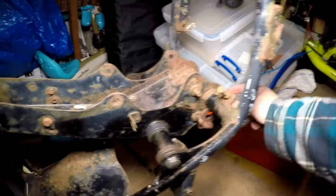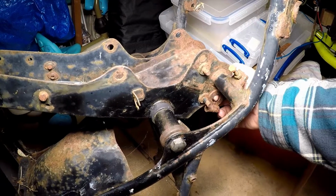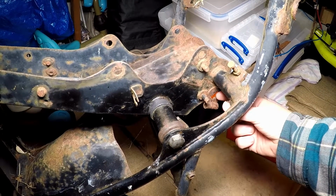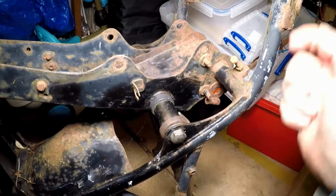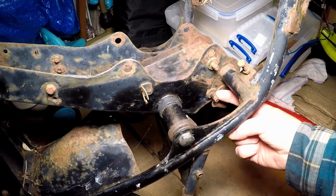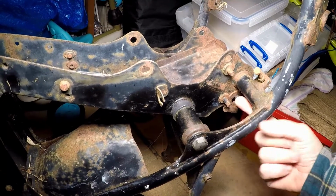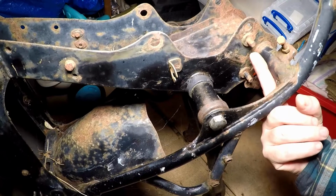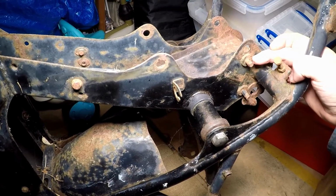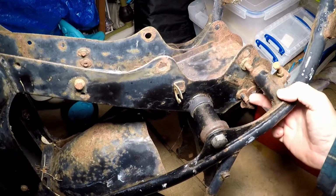So the centre stand sits the other side of this plate on the inside here. The pin for the centre stand comes out through here, and then this is where the rear brake lever attaches that you saw in the previous section of video. And literally right above here is this pin, and this is the pin you want to pay attention to on the frame. There is another pin forward of it here, and this one is for the rear brake spring that comes off here.